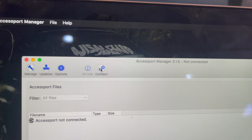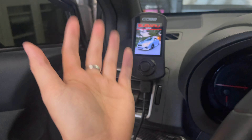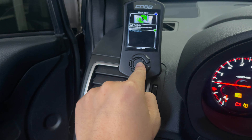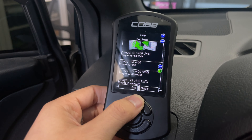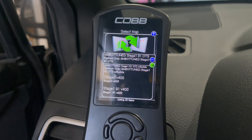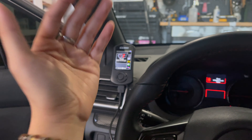Now we can eject the Accessport from the manager and it's all set. With the Accessport plugged into the car, all you have to do is flash the tune. I got a little too excited and forgot to record this part, but on the Accessport you go to the Tune section, select Change ECU Map, hit ECU Reflash, and you can see all the tunes loaded on the device. I was previously on the Stage 1 91 v400 with the normal wastegate. You choose your tune — either with or without burble from Ambot — follow the on-screen instructions, and just like that you have a new tune on your WRX.